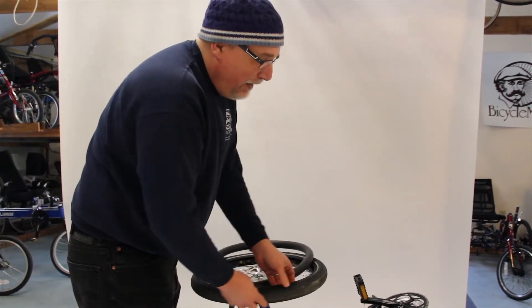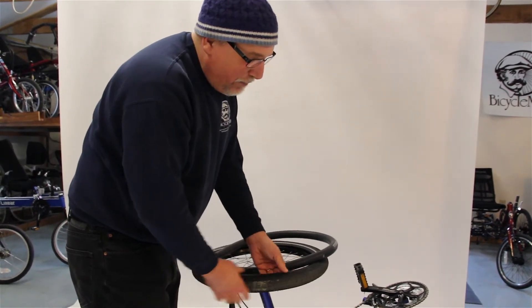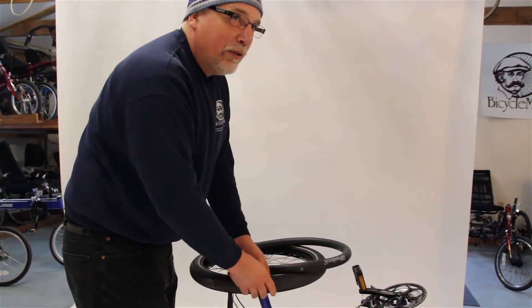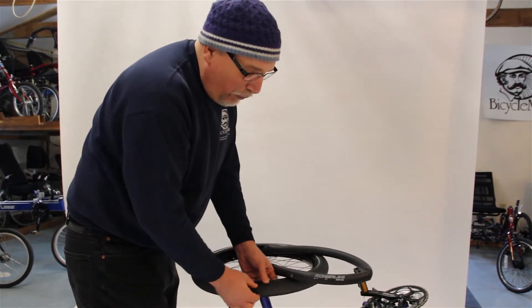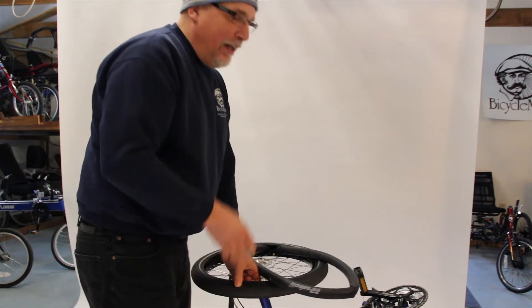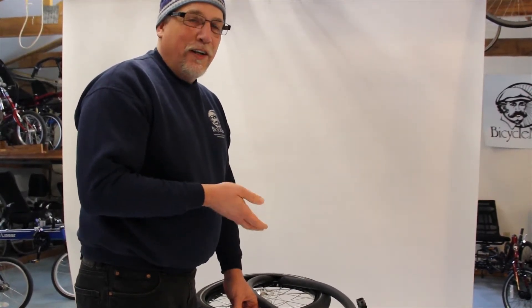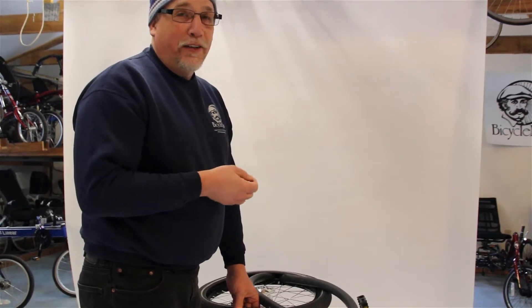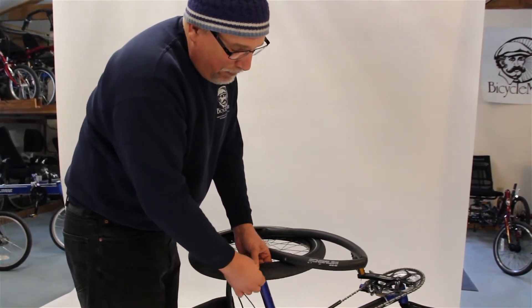If I don't find anything, I'm going to very gently rub my fingertips along the inside of the tire really carefully so I don't cut myself, and just feel along until I feel something poke me a little bit. Then I'll know where to concentrate. It doesn't do you any good to fix a flat if you didn't get rid of the problem that started it — you'll just end up with another flat. So if there was a little rock or a thorn, I'd pull it out.